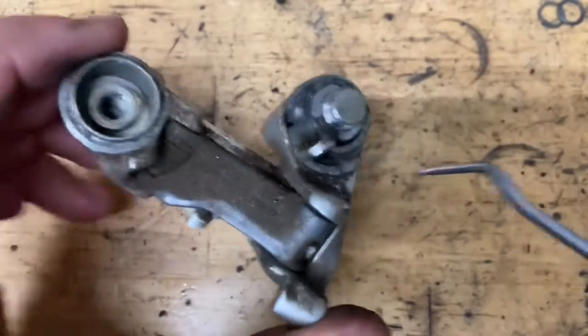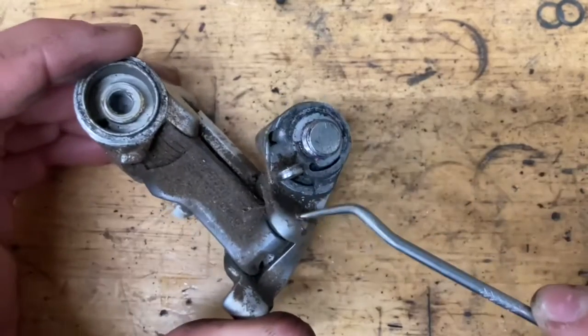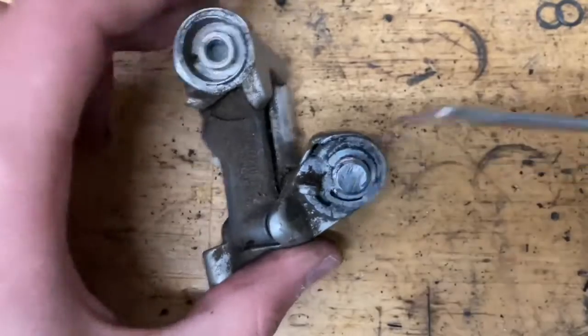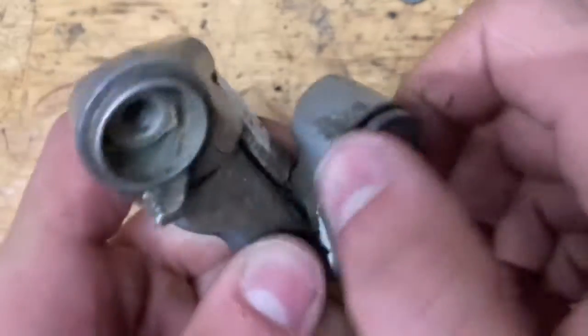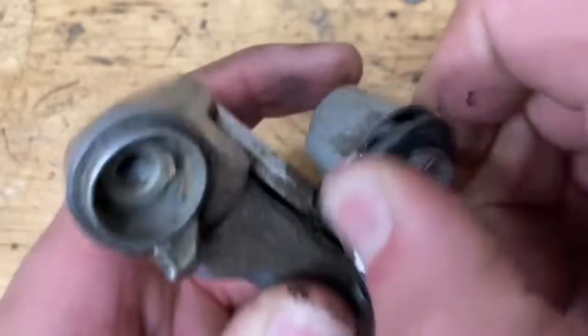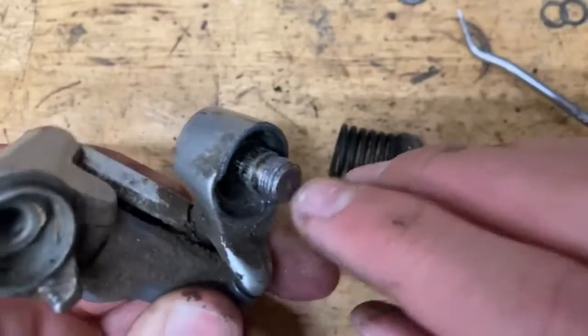Only for the Santé, I recommend taking out the b-screw after you pull this thing off, because there's not much space here and you can damage this little area. So let's take off the clip — get your pick and slide it off. Now just pull this tab out and towards you and it should pop out. Then push out the bolt.